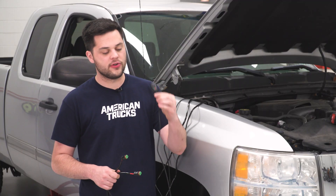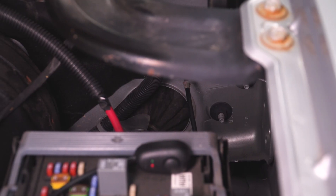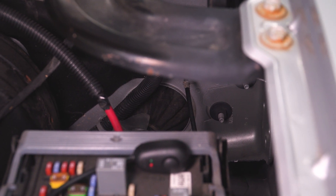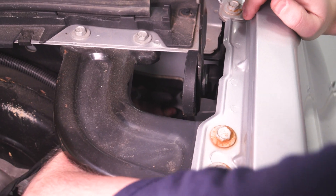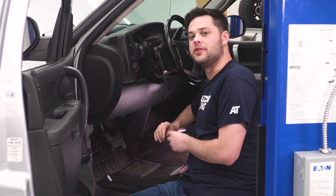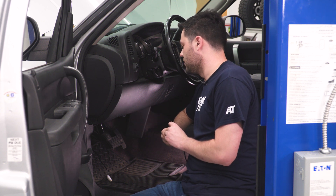Now we've got two more things to do. First, this switch is gonna go along the firewall over to the driver's side, and these plug-and-play connectors here we're just gonna fish down underneath our truck. Be careful with these — you wanna make sure they stay away from any hot or moving components. Over on this side, we're gonna take care of our switch. Right here you can see that large rubber grommet — I'm gonna push the switch through there. I removed the fuse box lid just to make a little bit more room for my arm. Once you pull that through on the other side, you have a pretty hefty amount of wire, and you can put this wherever you want. It's got some adhesive on the back of it — stick this guy wherever you want.